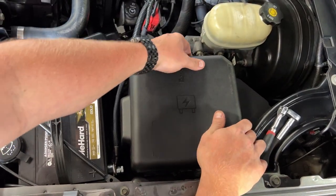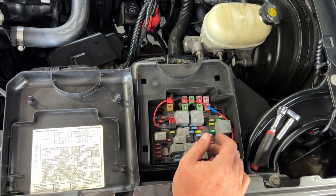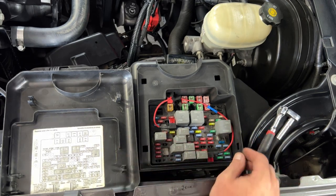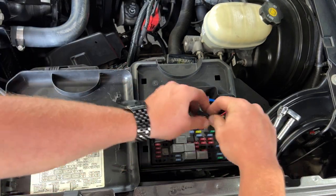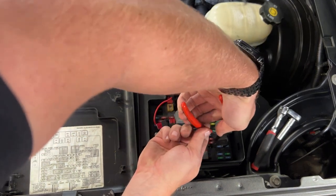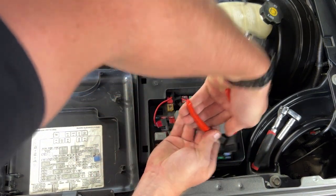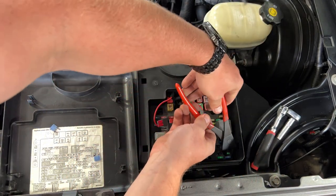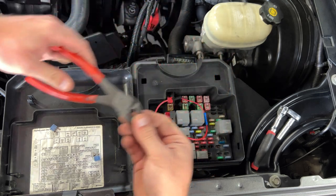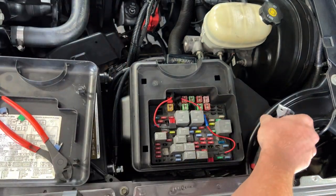Now we're going to pull the fuses for flashing. If you're going to read the ECU in the truck at low speed, pull these fuses first. Three important fuses help control voltage so you don't have issues when flashing. Grab a set of pliers: first is the 15-amp radio fuse, next is the 15-amp info fuse, and the last is the radio amp fuse. Whether your truck is a Bose truck or not, pull that last fuse — I've had a lot of guys with base trucks that couldn't read or write until they pulled it. Now let's get in the truck and do some data logs.